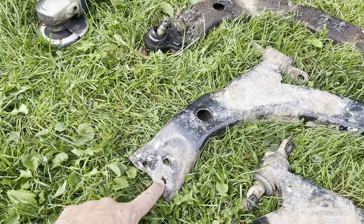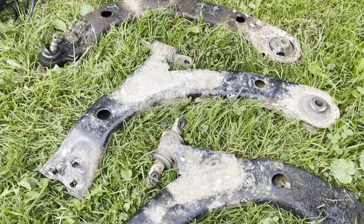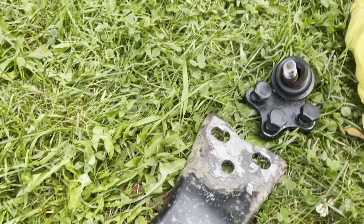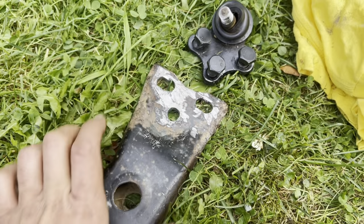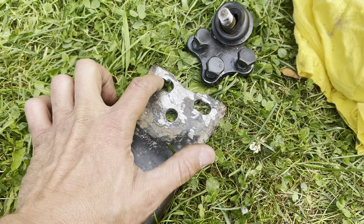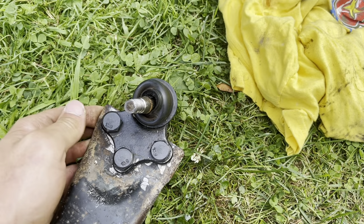This one here I didn't touch it - you see there's the tip that used to be there, just kind of popped out after I went through. Going to unbolt that and this is the driver's side - might have to widen the holes a little bit to fit those bolts. Then that driver's side control arm should be good to go, and then the passenger side I'll do the same thing. Hindsight is 20/20: when you're using a Cobalt control arm and a non-Cobalt ball joint, it's going to have a different hole displacement - so don't drill through the old Cobalt ball joint holes. Had to widen and expand a couple but it should still be a good strong piece. She bolts right in there.